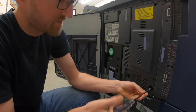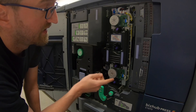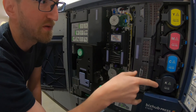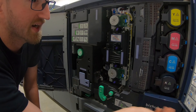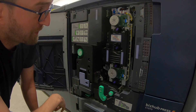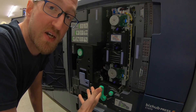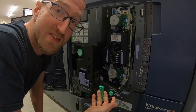Opening it up — here are your four wires, and the color corresponds with the toner. Open up your toner compartment and you can see yellow, magenta, cyan, and black. Magenta and black are the two that look bad. Typically I replace all four at the same time so you have more uptime, but in the interest of science we're going to test one at a time. Magenta was the worst, so let's pull that one out first.